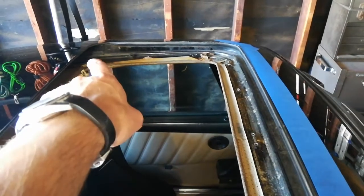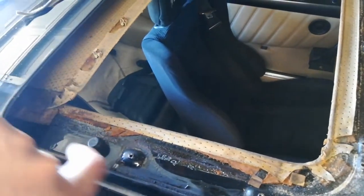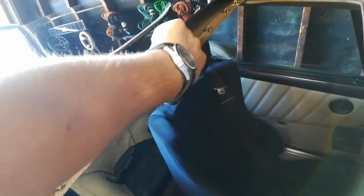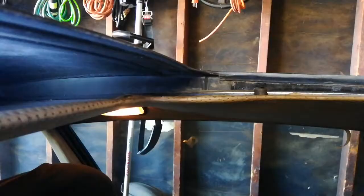After you've removed all of the aluminum side trim, the air deflector trim, and the cable channels on either side along with the cables, there's not much else in here to remove. At this point you can grab the small headliner panel of the sunroof and pull it out and put it in a safe place. Then come into the cavity where the sunroof lives when it's retracted — between the roof sheet metal and the headliner — and clean out as much dust, debris, and general junk as possible.